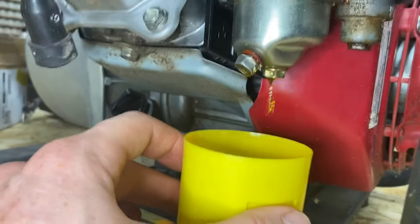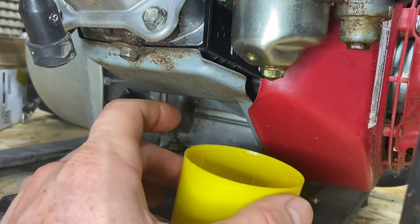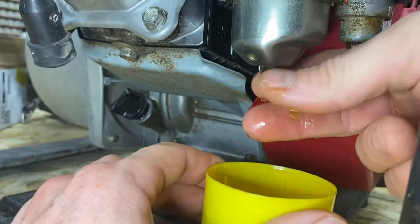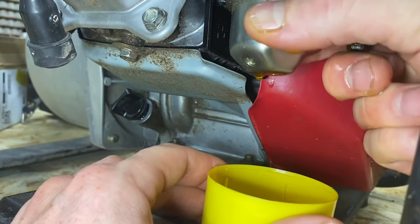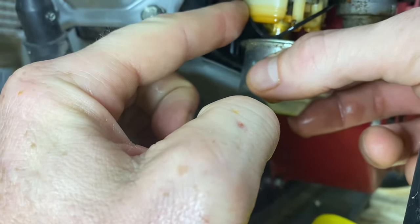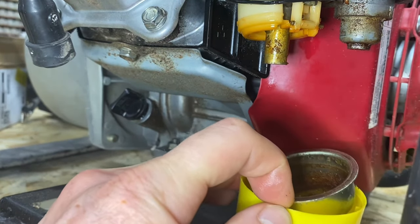All right, you can see we're starting to dribble. I'm going to have to just unscrew it and see what happens. Oh my gosh, that stuff reeks. Most of the gas has already been drained out of it, so we should be good. Go ahead and take the main one off too, and once you take that one off it should drop that bowl out. I have not worked on a Honda motor in 20 years since I was 21. Oh look at that - just be real easy when you take this thing off because you do not want to tear that bowl gasket. We're a little stuck, she's a little corroded. This thing is gnarly. Obviously we've got some work to do, but that's the first step - drain it and pull that bowl out. Make sure to have something to drain it. Let's go ahead and go to the next step.